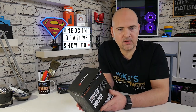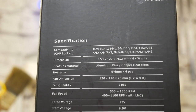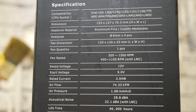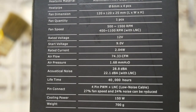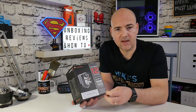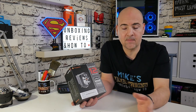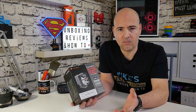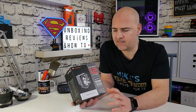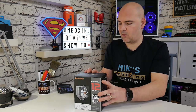If you want a closer look at the specifications I'll put those on screen now. Essentially this is your basic 120mm tower cooler, but one of the features I particularly like is the ease of fitting. This is a super simple cooler to fit. A lot of coolers on the market require you to replace the backplate, put different pillars on, and deal with a whole host of clips — it can be a real pain. But this cooler takes away most of the guesswork and makes life a lot simpler.